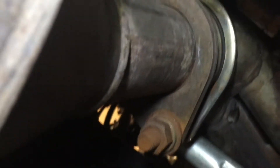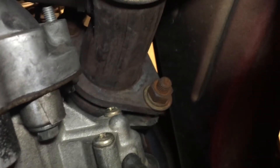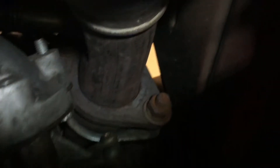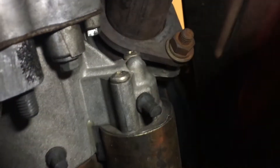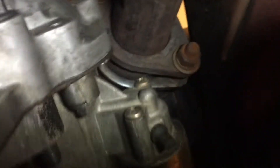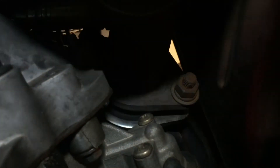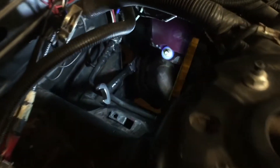From underneath the car we're going after the exhaust bolts. On this car it's 19 millimeter — not sure if that's aftermarket, seems a little big. There are two on each side. Make sure the battery is disconnected because we're near the starter, and anything metal near it with the battery connected will make sparks fly. Feel free to use liquid wrench on these exhaust bolts — with all the heat they see, they can get pretty stubborn. Spray them down and let them soak for a minute.